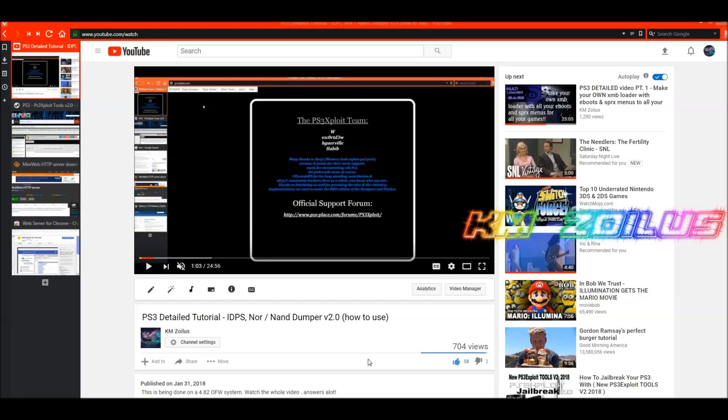Not having the USB stick plugged in is a pretty big deal, because some of you are having issues with your USB stick — specifically the flash hex file not being read properly off of it. I experienced this with version 1.0 of this exploit, and as soon as I switched to another USB stick everything worked flawlessly. This method will help because it reads the file from within the hard drive of the PS3. I'll also show you two different local server options for your PC.